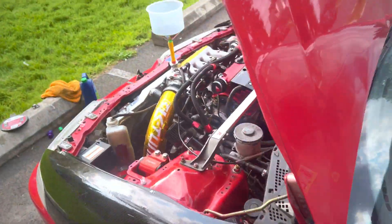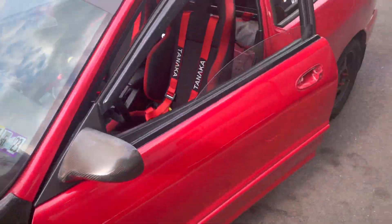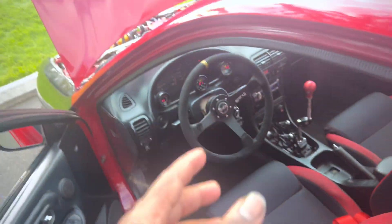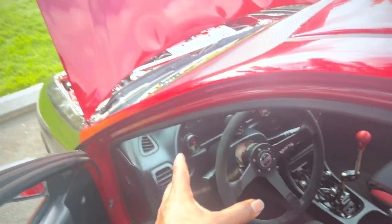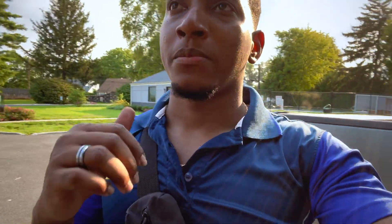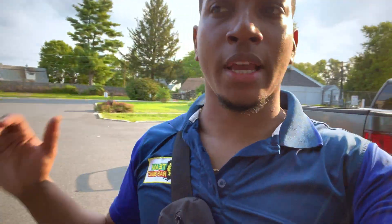When I say these K-series are a nightmare to bleed — don't change your thermostat unless you really have to, because I'm spending most of my time bleeding this car. The car is now bled. This thermostat likes to sit around 190 degrees with the car not moving, which imitates being in traffic. It stays around 190 and doesn't climb after that with the radiator fan on — that's a plus. I'd really like it lower but 190 is fine. We're going to jump in his car now, do a review, and wrap this video up. Man, I'm exhausted.